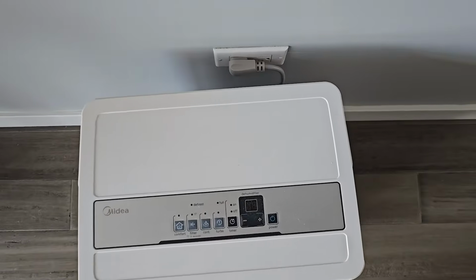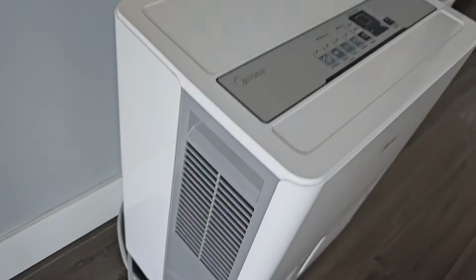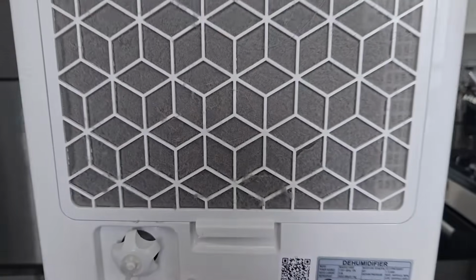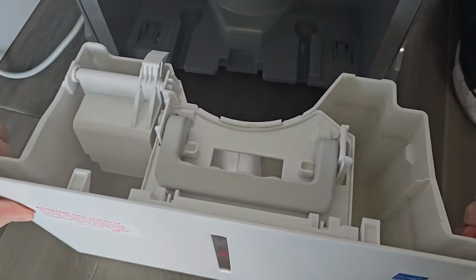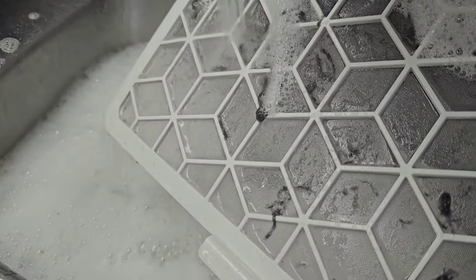During periods of frequent use, lint, dirt, dust, dander, and other debris sucked into your dehumidifier filter build up, impeding circulation and reducing efficiency and performance. So unless you like the nooks and crannies of your body moist and musty during the dog days of summer, you need to clean your dehumidifier filters at least every 2 weeks. Luckily, doing this DIY task is a breeze.